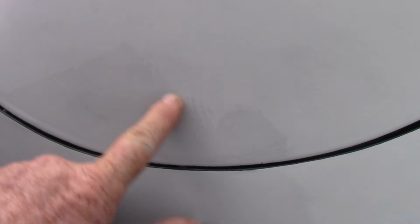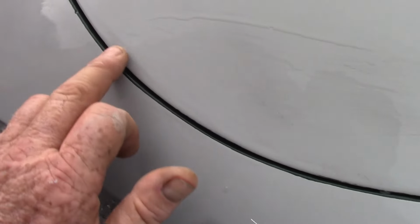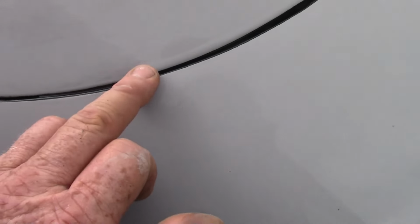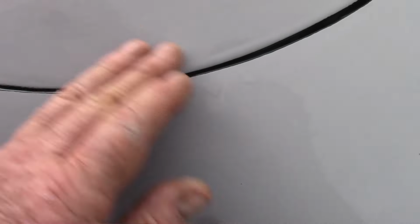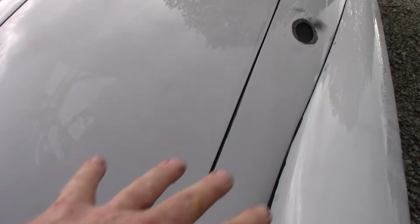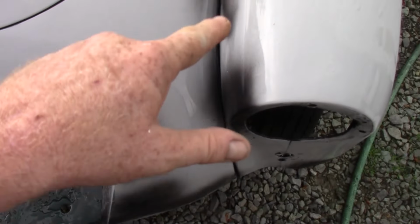See the scratch marks? That's guide coat. So we need to go over this with 400. And any place we see stuff like that, we've got to catch it now. Now that we're rinsing it, all the little grooves out, now we can see them. So let me get my soft block and my 400 wet, go over this hood, go over this area. We're gonna go over the primered spots and get them prepped up.